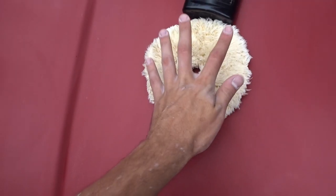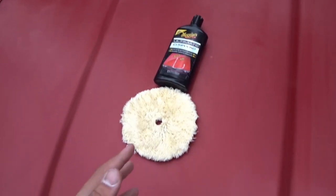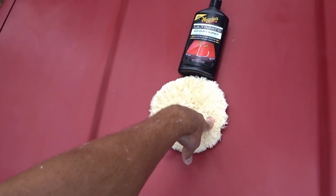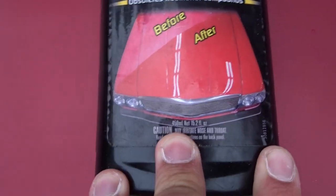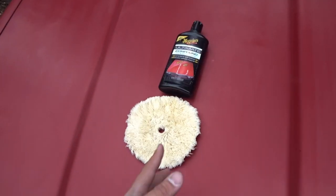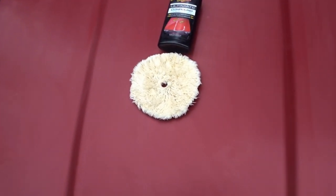I'm genuinely past pain — I just don't even feel my shoulder, it feels like a dead appendage stuck to the side of my body. I'm gonna take a good rest and come back once it's completely dry to start buffing. For buffing, we've got a wool buffing pad and I'm using Meguiar's Ultimate Compound. I did some test buffing on another car using wet sanding and the wool pad is definitely necessary over a microfiber pad because it just cuts more, and the Ultimate Compound did the best.